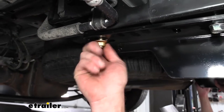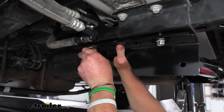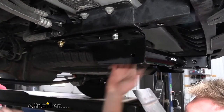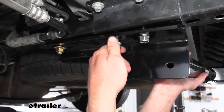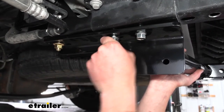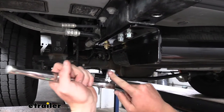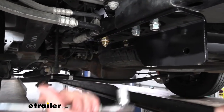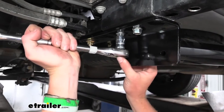Get these somewhat hand tight and push up on the hitch as much as you can. Make sure it's nice and flush with the frame, then do the same for all remaining holes — three on each side, both driver and passenger. For the two silver bolts, that's going to be a 17-millimeter socket. The one in back is going to be a 19-millimeter. Take it with the ratchet and get it nice and snug before torquing it down fully.